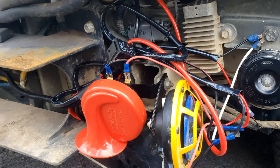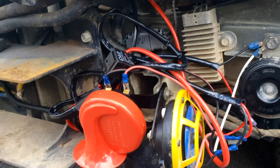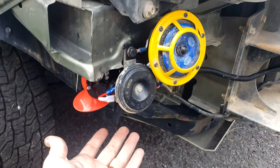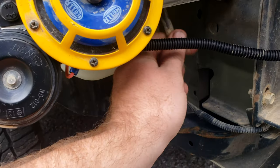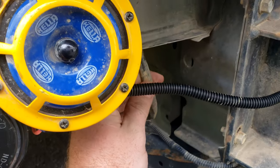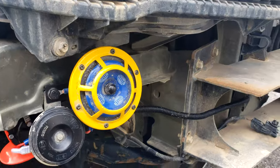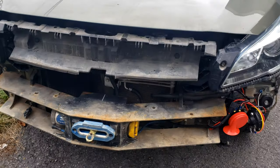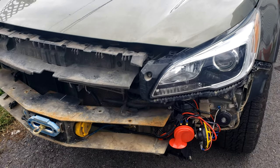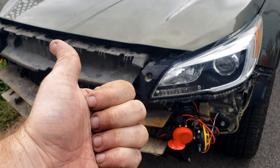I think it's safe to bolt everything back up. I'll go ahead and put the bumper on now and we're good to go. Actually, I just realized with the factory connector here, you could connect it — so you could actually have two harnesses. Theoretically, you could have 50 amps of horn, if you so desire. But I do not — I just wanted to show off what you could do. Hope this video helped somebody. Thanks for watching.